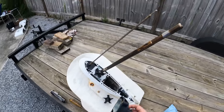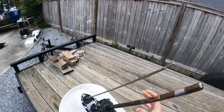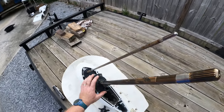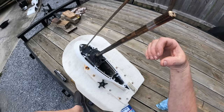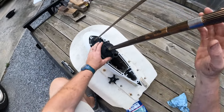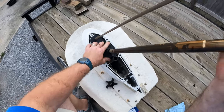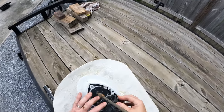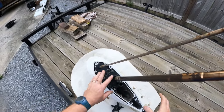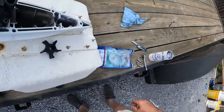Here's a very important part: when you get your cap back down, apply a little bit of pressure, take your hand and spin that shaft, and that will roll the impeller in the direction it needs to go. Just like that — very simple, very easy. You know you have your orientation right and you will not have issues in the future.